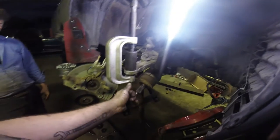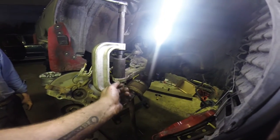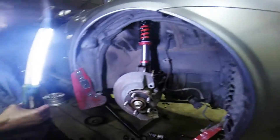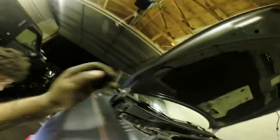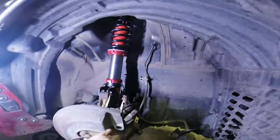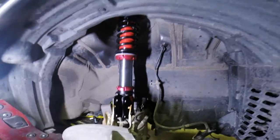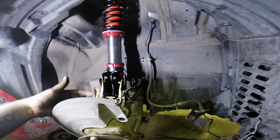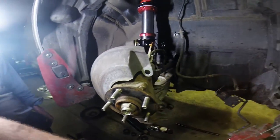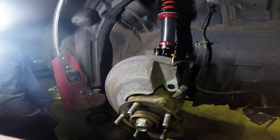Medium cup, lower cup, and it's already moved down, so we just have to loosen it out and press it. We used a tall cup — I just put it right on the ball joint. I had a buddy here so we were able to start by hand, just tapping on it to get it halfway up. Now we stuck the new shock up in there with the three bolts, hand tightened them up good and tight. We just have to line this up, match it up, put the bolts through it, got the bottom down, then tighten the axle nut, put the rotor on, and we should be ready to test fit.